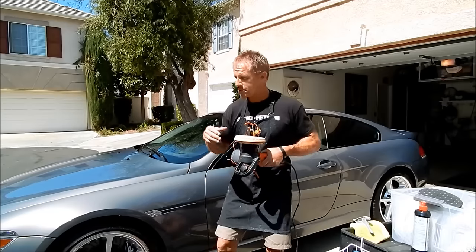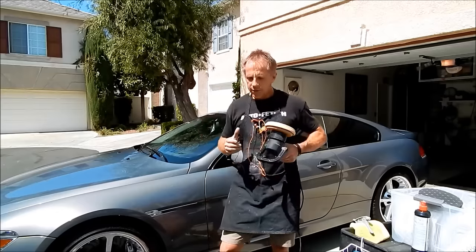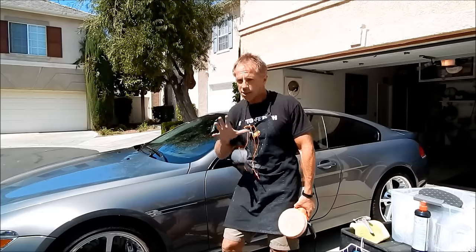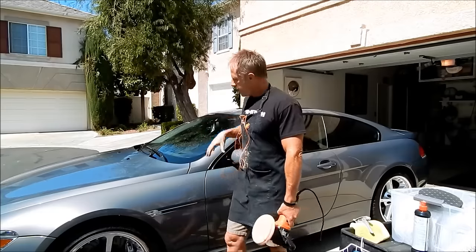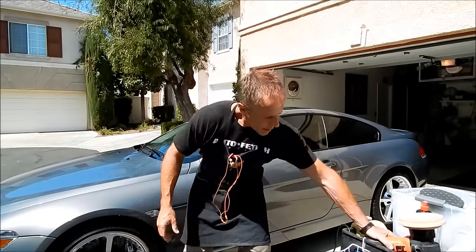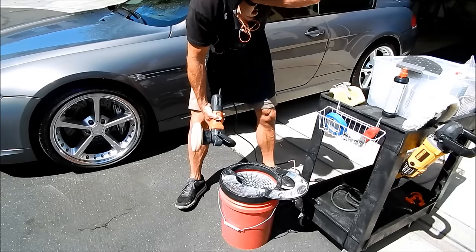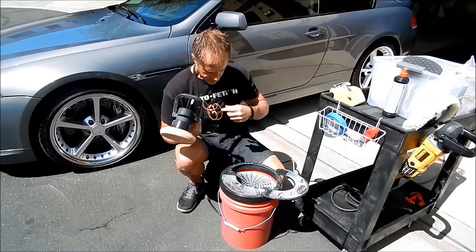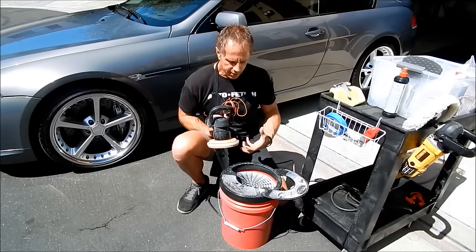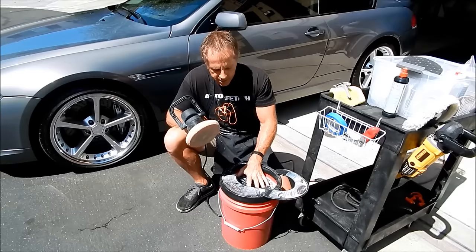Hopefully you don't have to go into reactionary mode because you're getting bad results and panic. Yes, that will happen to you — and that's where you reel yourself in and choose an appropriate response rather than an inappropriate reaction. Responding mode: good. Reactionary mode: not good. Now let me show you my pad washer. If you're going to do serious polishing, this is essential. One tip: if you use headphone wires to listen to music while buffing, watch out — the wires drop down onto the buffer and get caught. I always pre-season my pads, which is one of the main reasons the pad washer is so ideal.